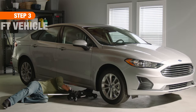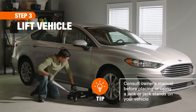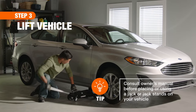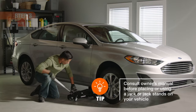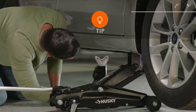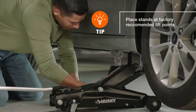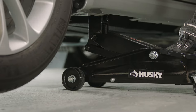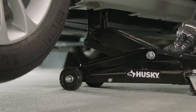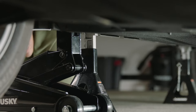Next, at the front end, slide a jack into position under a factory-recommended lift point and raise the car until the front tires just clear the ground. Continue to raise the car until it clears the height of the jack stands. Place the stand into position under the car near the front wheel. Repeat the action on the rear of the vehicle, then lower the car to rest on the stands and lock them into place.